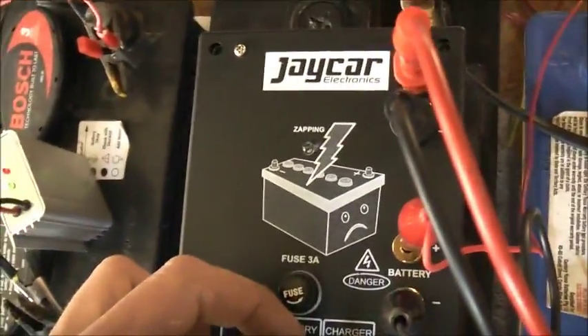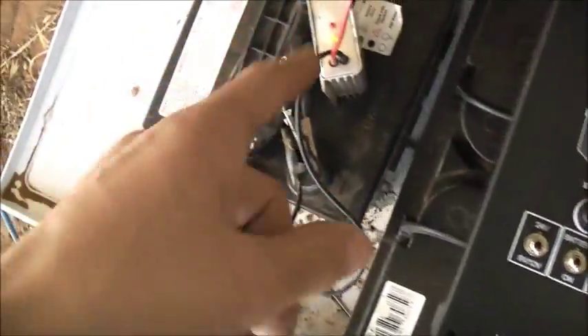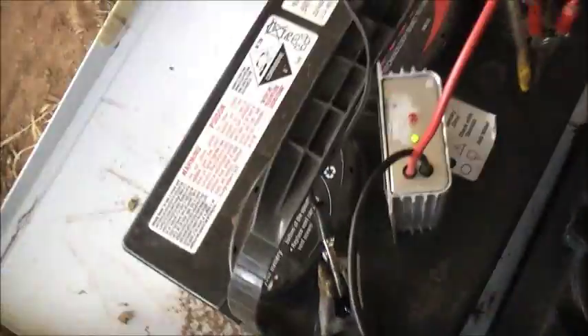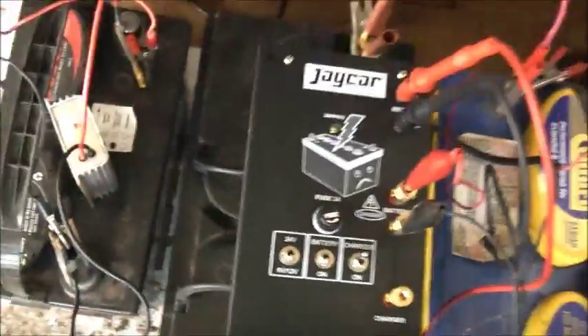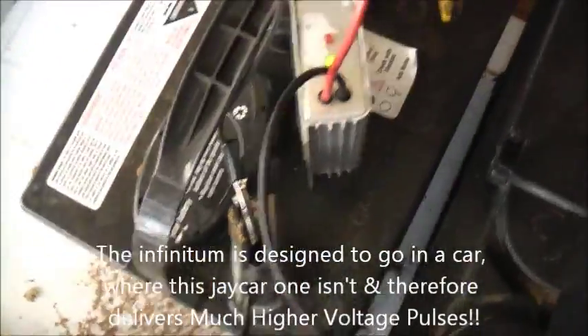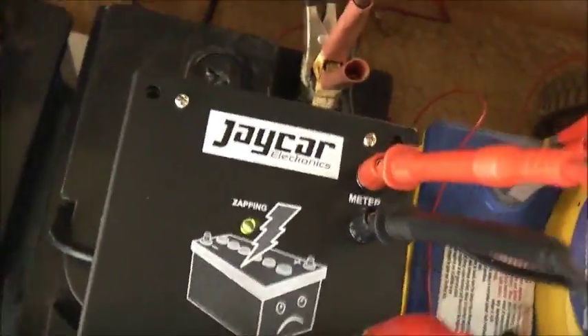24.6 and 12 volt battery on, charger on, and we've got the charger connected. Turned off altogether — there we are. I might permanently install this in my car now, like I originally intended. I'll stick that one in the unit and that can stay in there. This one here can take over because the other one is really only meant for one battery — it's a smaller unit. This one physically delivers bigger pulses, so this should be much more effective at getting four batteries at once. It is making a high-pitched desulfating pulse, so it's working.